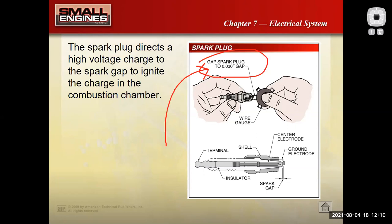One other thing I would say, let's say you're working on your car and it's got double platinum plugs on there. Do not use one of these gapper tools because it will chip off the platinum pieces. So what you'll find is if you ever buy platinum plugs, they'll come with little tubes over the spark plug electrodes. And that means that those plugs are pre-gapped. I just look at the gaps to make sure that somebody didn't drop the plug or something, that the gap looks correct.